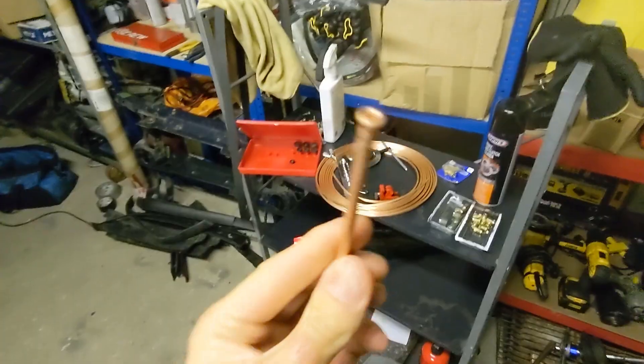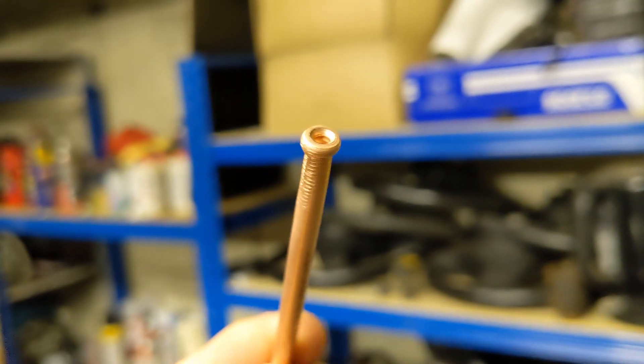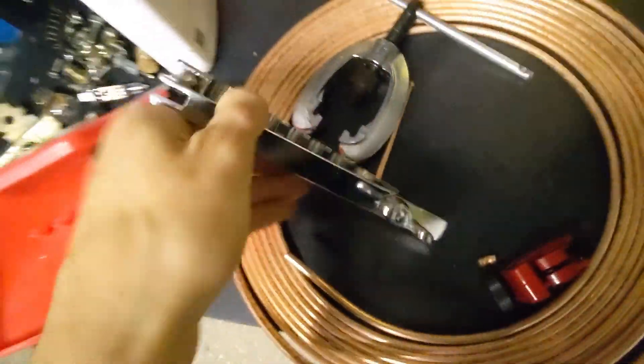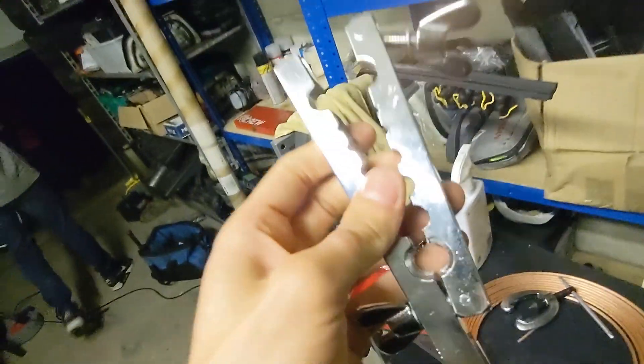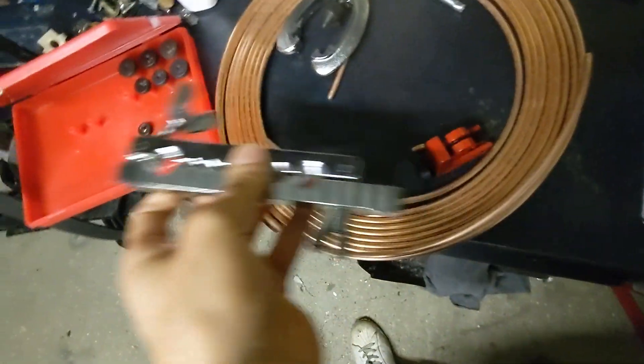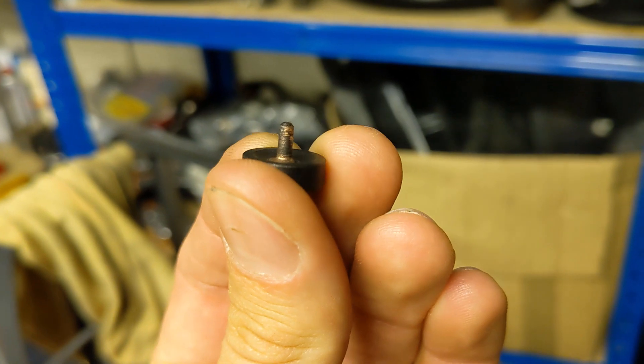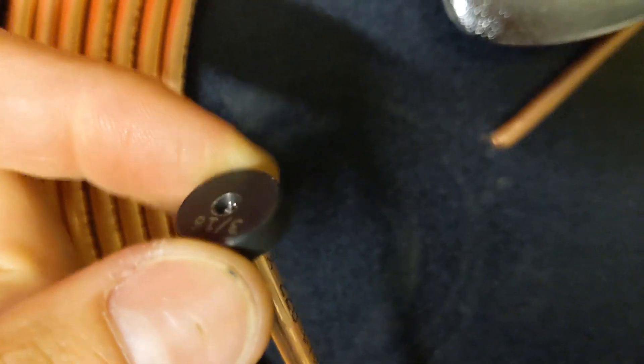Here we have a successfully flared brake line — look how legit this is! I did this. Harry's here actually, hanging out — he doesn't like being on camera so I won't put him on there, but he was giving me loads of tips. This tool is actual Chinese trash, don't buy it. The issue is that the nipple thing you use to jam into the line and press down to flare it — the actual stem part that comes out — is too thin for the opening of the brake line, so when you put it in there it wobbles and goes sideways.